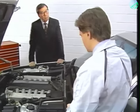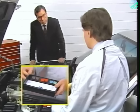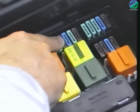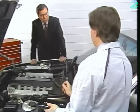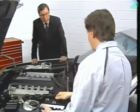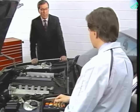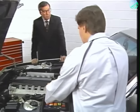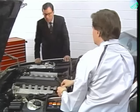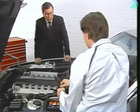Let's look under the hood so I can point out the fuse box and a few other things you should know about. This is the main fuse box. As you can see, it has spare fuses, a fuse puller, and electrical relays. If a fuse blows, you can spot it by the melted metal strip inside the housing. Remove the blown fuse and insert a new one — make sure you replace the fuse with a fuse of the same rating. You don't ever want to replace a blown fuse with one of a higher capacity or with a wire — that's dangerous. There are a few more extra fuses in the secondary fuse box under the rear seat. If the battery is under the back seat, how do I jump start my neighbor? Here's the battery connector — you just attach the positive cable to this clamp and the negative to a suitable ground point and you're ready to help.